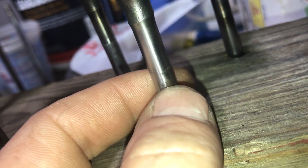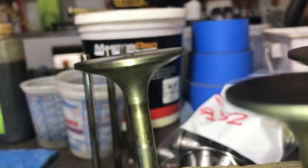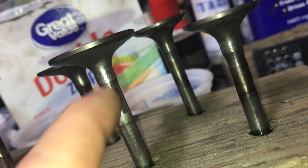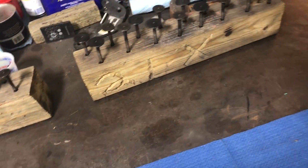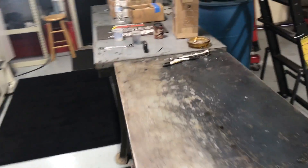Let's see if we can tell which ones have been moving. You can see — that one's just regular, not too bad, and that one right there is all kinds of shiny. Looks like the liner was moving around. I'll spec these valves out too — it's probably just going to turn into a full-on do-the-heads job.